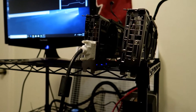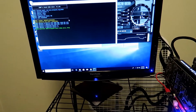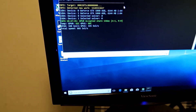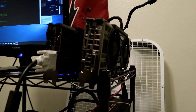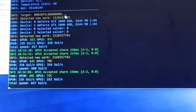I plugged into the For The Win edition. On this mining rig the Pentium is not as strong as an i5, so the GPUs take more of the grunt work of calculations. GPU Zero is still running at 340, and the Super Super Clocked is running at 325, which is low — normally it runs about 340 also. I'm going to let this run for a bit and come back. We're looking at the Super Super Clocked not plugged into the VGA and the For The Win plugged into the VGA, with the box fan running behind both cards.